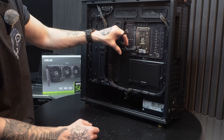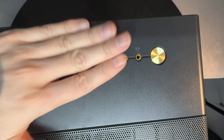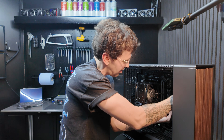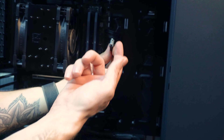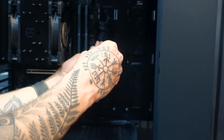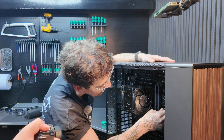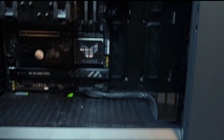Then it's time for the USB-A and USB-C connections onto the motherboard so that you can get the USB ports on top working. You'll just have to line up the groove on the connector with the groove in the socket. There's a slightly bigger corner edge on the USB-C connector — if you match that to the bottom of the port, you'll be able to line it up. If you're not feeling it go in, try not to wrestle it in. You don't want to break your motherboard.